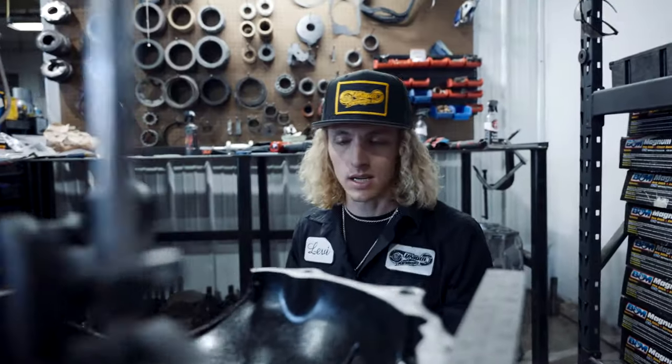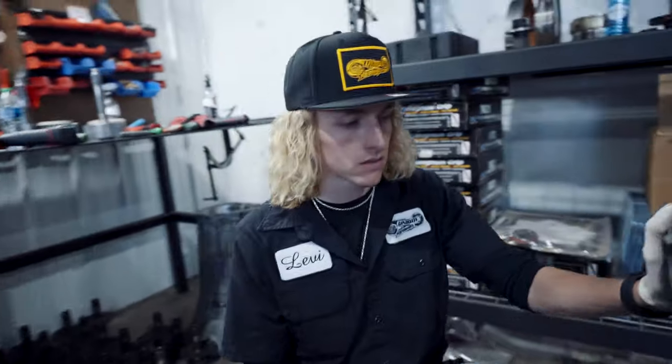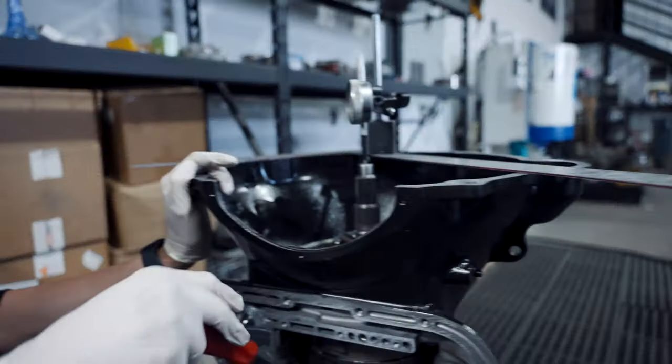So we'll be back, pull it apart again, put a different selective in, try again. We added a secondary shim on the direct drum. We had a 57 thousandths selective and we went to right around an 80 thousandths. So we took out about 30 thousandths.